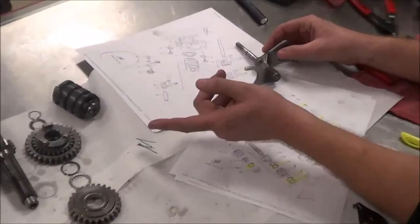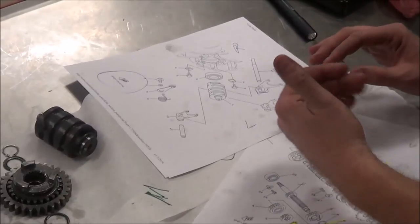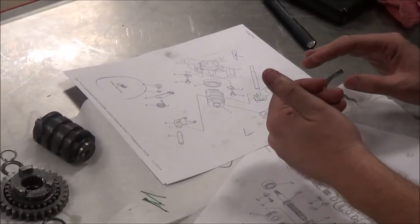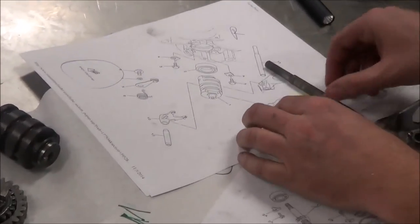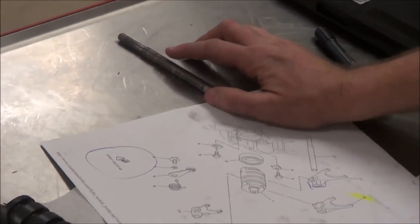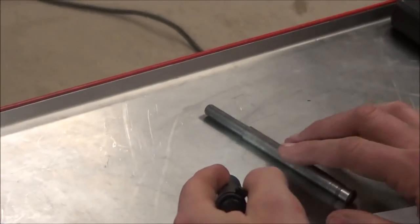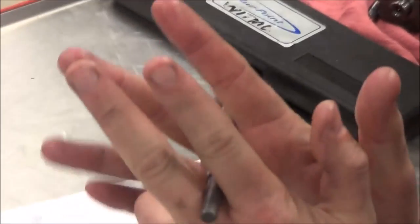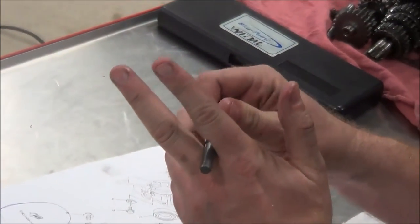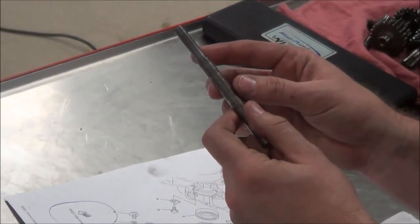Okay, well, the last thing, since the drum is good, we know the fork and gear is bad. We really believe that that happened because of that homemade washer, right? The other thing we need to make sure is that this pin is not bent. So a lot of people will roll it along a bench here and try to look for a wobble, shining a flashlight right here. We could put this on V-blocks, remember what V-blocks are, where we put it on a tool like this with a dial indicator and we spin it and we can actually measure it. The ideal place to go roll this would be on that granite block and actually see if there's wobble.